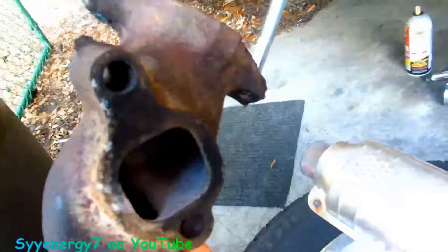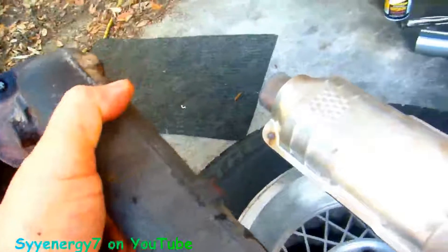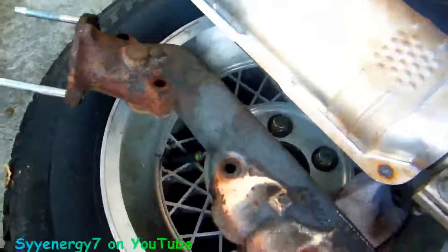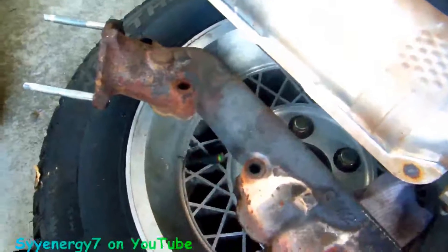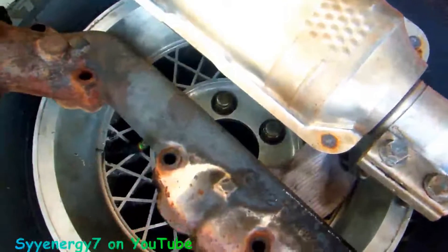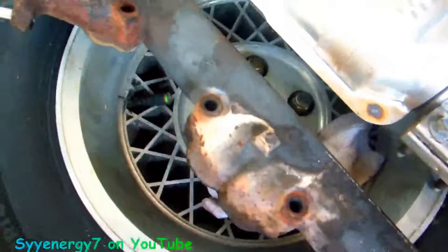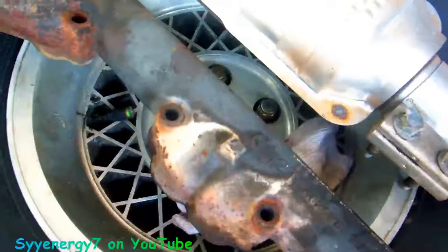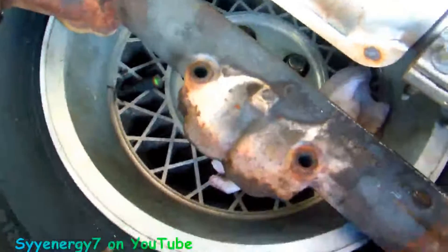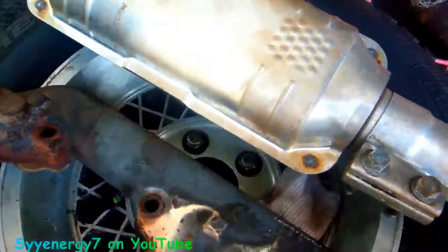I might soak this thing in the vinegar and put it in the oven at 400 degrees and bake it — probably do the other side too, so it looks nice. It'll be silver aluminum with that POR-15. And what I'm going to do with the exhaust system is wherever I see any little rust, I'm going to go over it with some of the POR-15 high heat.